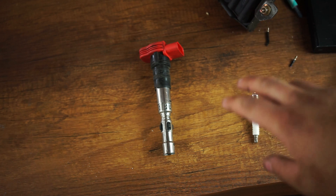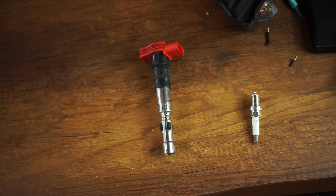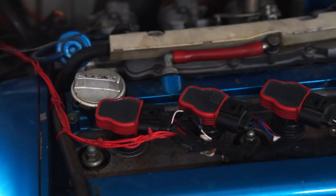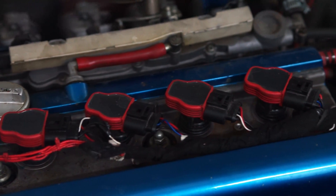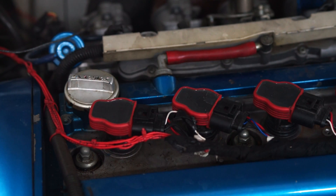With these coils you will need a different wiring harness for the coil-on-plug setup, but don't worry — it's pretty easy and can be done within about half an hour if you're reasonably fast. As an example, we have a Toyota 4AGE 20-valve four-cylinder engine here that I've done a COP conversion on, and I want to show you how to wire all of this because pretty much all of you should be able to do this at home.